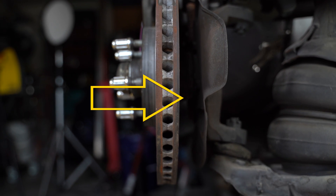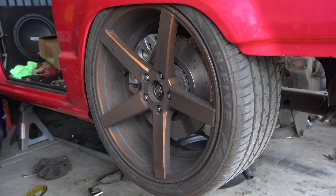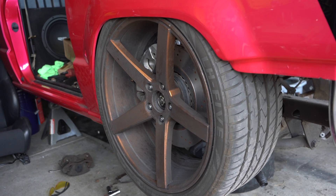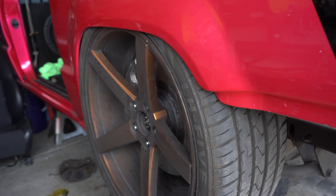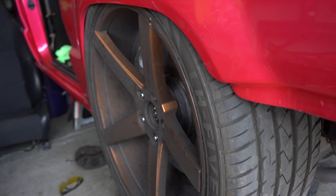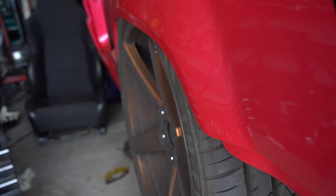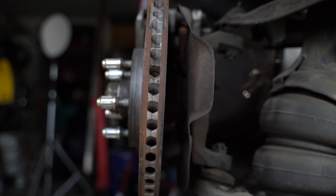The main goal is to get the wheels to pull inside the fender more. Currently the tires rub on the fenders and I can't even lay the thing out. So the wheels need to pull in about an inch and a half, maybe two inches. There are much easier ways around this, like getting different wheels with a different offset, but I really want to use these wheels. To me there's something really special about using something that nobody else will — meaning nobody else will be willing to do the work to make these wheels fit.